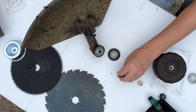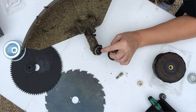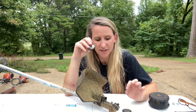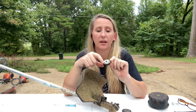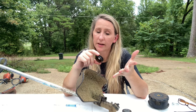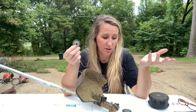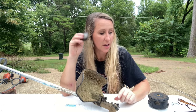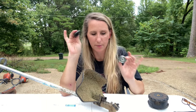The Shindaiwa is not as simple as the STIHL and Husqvarna - they have multiple back pieces to put a blade on, and throughout the years they changed the inside spline. You're going to have to look up your specific Shindaiwa model. A lot of times if you put an X at the end of the model number, that'll be the brush cutter version so you can find the right pieces. You want to find the piece that has a raised lip for the blade to sit on. Easiest way is to call your local shop - they might have it.